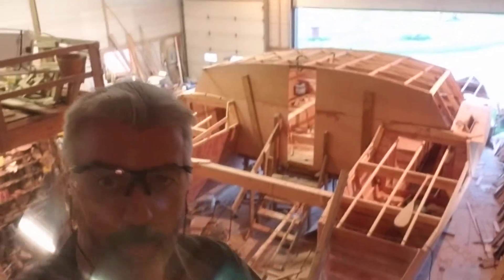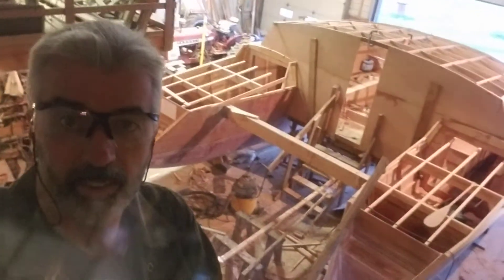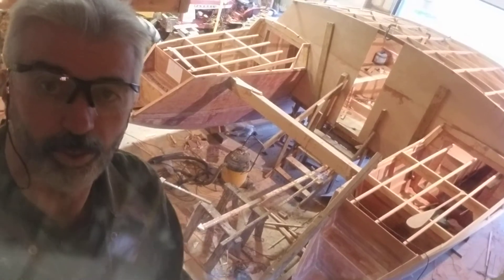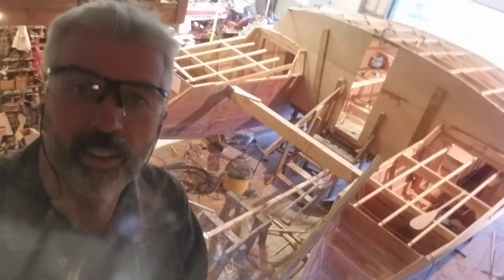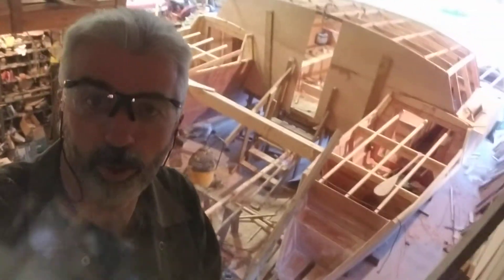Here's a view of the Tamar with the steps completed that I started on Saturday. Today is Tuesday night. I had all the pieces cut and pre-fitted Saturday, and I thought I would just grind down and put everything in place — epoxy and fiberglass it in. It went in perfectly but it just took four times as long as I thought. So if the whole boat goes like this, my planned year and a half will be a six-year boat building project. Which is okay because it's awesome.